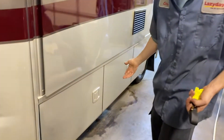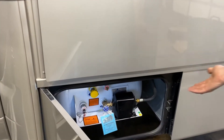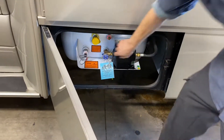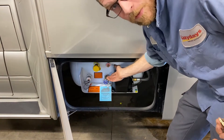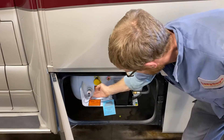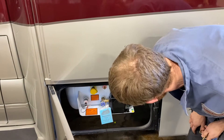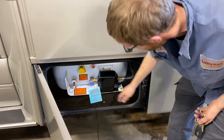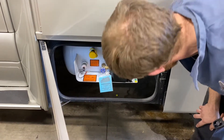The first compartment is propane — it is not lockable by law. In case of a fire due to gas, number one you exit the unit and get everybody out; number two, come out here and eliminate the source. Close the valve all the way to turn off the gas. If you want to use a gas appliance like your furnace or water heater, turn the valve all the way open to the left until you can't turn it. The gauge here is wired to the monitor panel inside so you can see the gas level both here and at the monitor panel inside. You can fill up at some gas stations, most travel stations, U-Hauls — just do a search to find where you can get LP.